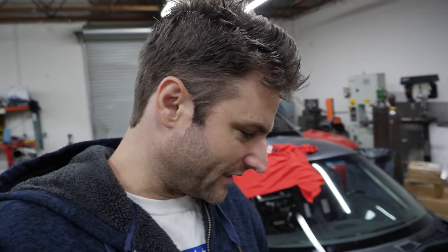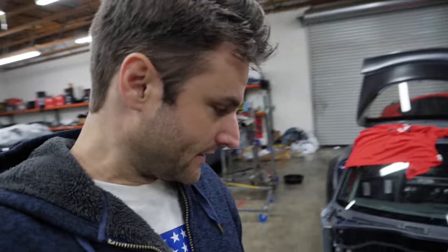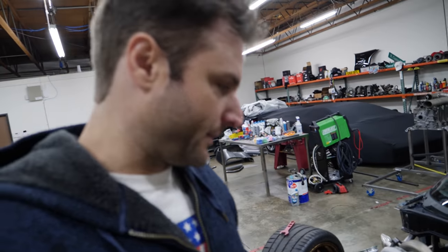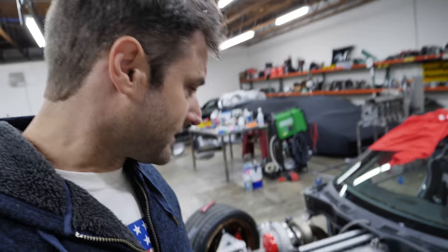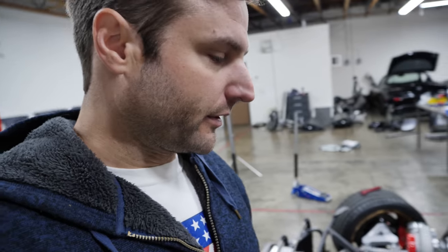I really do need brakes — I don't have them on the car, even though I can stop with the handbrake and that's really sick. That's a quick wire-up in my opinion. I also need to modify my dry sump tank — it's got a 12 AN inlet and that is just not adequate. That's part of the reason why the system was causing back pressure through the turbo. We gutted most of it to 16 AN, and that dry sump tank outlet is the last piece.